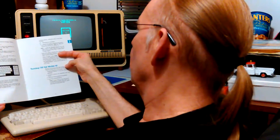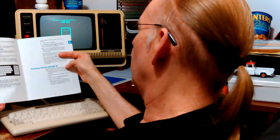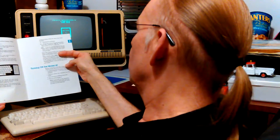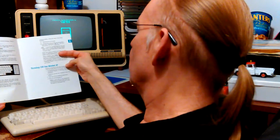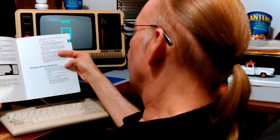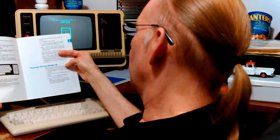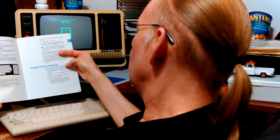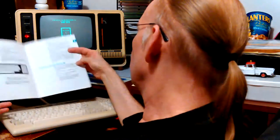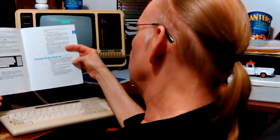Yeah, at the bottom of the startup, it asks for the date. Enter today's date in the format specified, for example, June 06, 1984. This was made in 83, I think, so maybe it was made in 84. It displays the date in expanded form, and then displays TRS-DOS prompt ready. And of course, it's already there. This one's not TRS-DOS, this is LS-DOS.